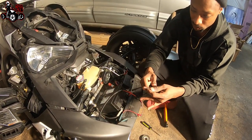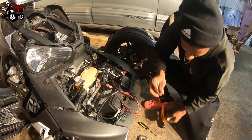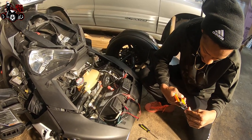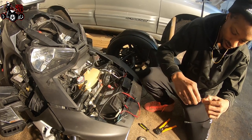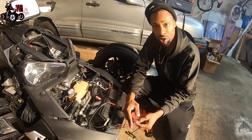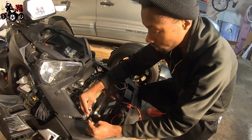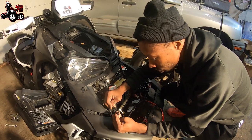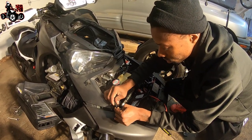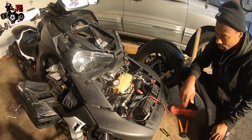Now that I got those hooked up, I'm going to hook these parts from the grill to the extension wire to my switch. I'm going to crimp these back a little bit more - they're already showing exposed, but I like to give it a little bit more just to make sure we get a good connection on there. Now that I got that connected, I'm going to take some black electrical tape and wrap it around here to make sure that's nice and snug together. Take your female side and put it with your male side and screw your screw tight. We're going to tighten up that screw there - you've got that nice seal on there, you can feel it. As you're screwing that tight, you can feel the tension from the little seal.